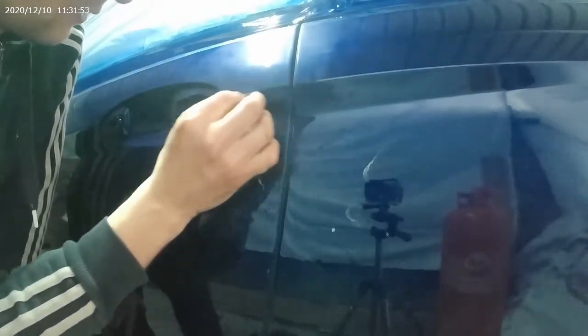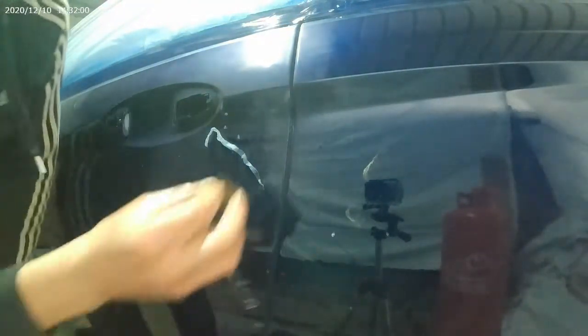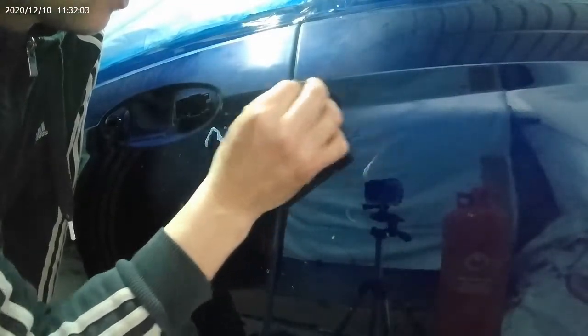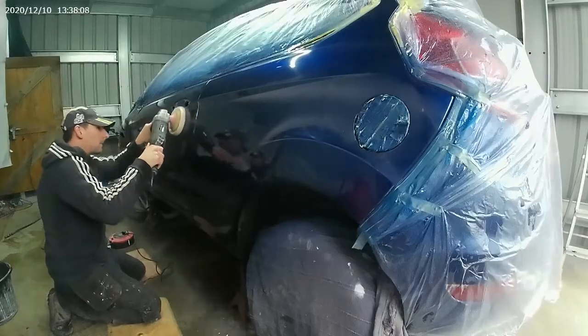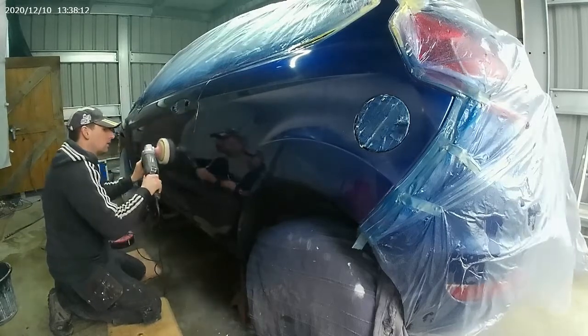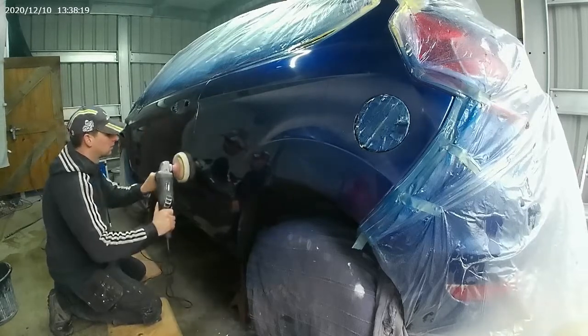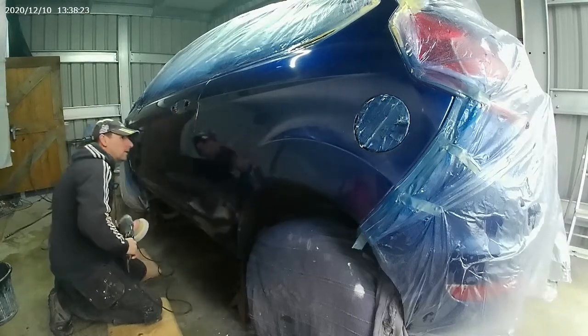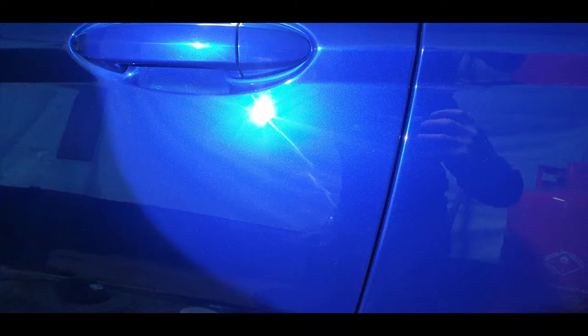I've actually flatted the whole panel down because there were bits in it here and there. I wet-flat panels anyway when I paint a car — I wet-flat the whole car down and just polish it all up afterwards. It takes quite a lot of time but you get a decent result. Now I'm polishing up that area — actually polishing the full side of the car — but this is just to show the next stage. You buff it up with some G3 buffing compound and that'll just take the run out. As you can see, it's very effective — you'd never tell there was a run there, and that's what you want. For future videos or more quality tips like this, please like and subscribe.